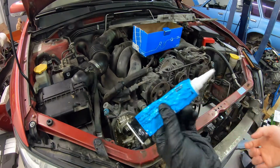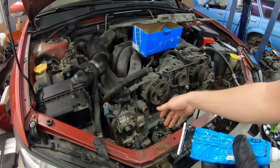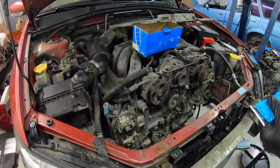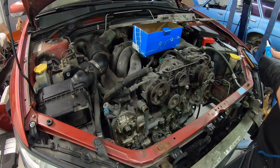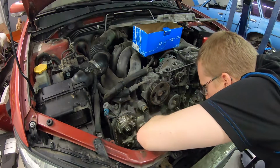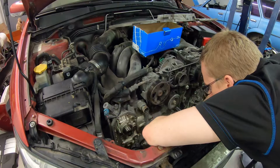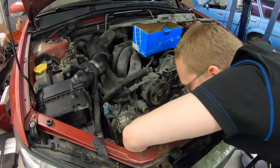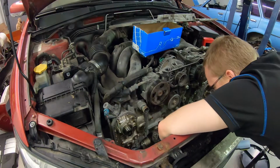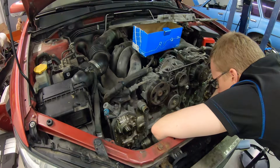As I said, I'm going to start with using some sealant just to hold the O-rings here, and I'm going with my cheaper option because it's not going to seal anything, it's just going to hold it. And while the present me is dabbing that sealant, the future me thought I should give you some advice. Instead of using RTV sealant like I'm doing here, I recommend that you use some sort of grease, like Vaseline or soap, to hold the O-rings in place instead.